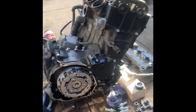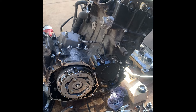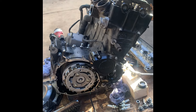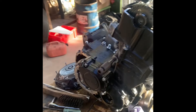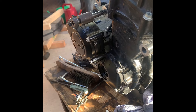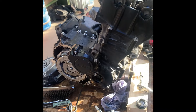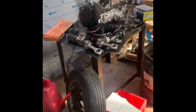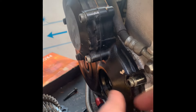Let's get started. Exterior-wise, we'll have a quick look at the engine. This is an S engine. There are a few differences between the S and the R. The S is probably more closely related to the K7, K8. One of the external differences is the timing cover here, which is a lot larger. The starter motor sits across a bit more, and the mount points on the starter motor are in a different place to the K8. I've got a K1 over here which uses the same cover and it is much much narrower across the bottom.